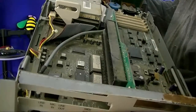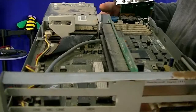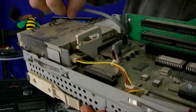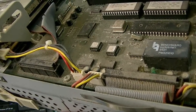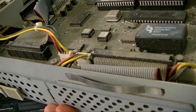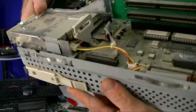And you see on this one, there's a diskette drive connector, and then these power connections. There's the lead for the M wave that takes it up to the front of the case, but these power connectors are on every point for every drive. For the diskette drive, for that one, the second one from the left, it goes down to like the CD-ROM area. So you could have that internal CD-ROM. And then the one on the right there, to the right of the IDE connection for the hard drive, is for the hard drive there.